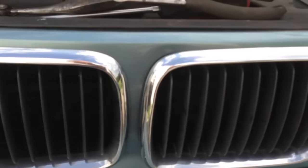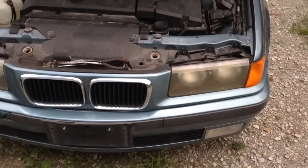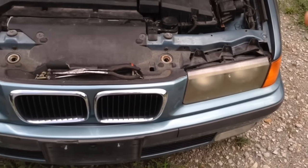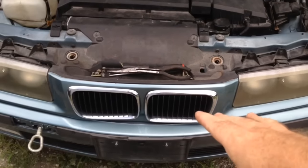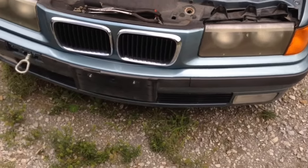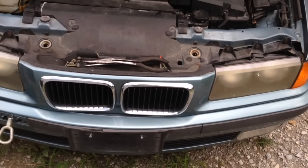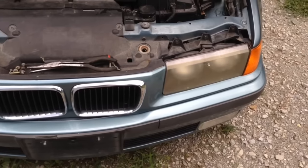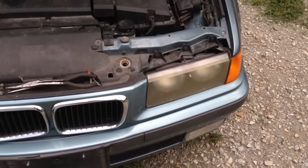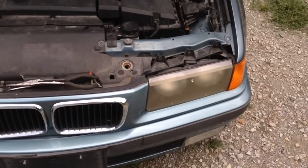Now let's give the third option — if that doesn't work and the driver's side latch is still stuck. If you follow these steps: start with the easiest inside the car, work your way to the corner light, and then go into the grill as a last resort. You don't want to break these grills. They're not that expensive but the problem is you might get an aftermarket grill that wants to fall out, bend the tabs on the grill holder or filler panel, and it goes downhill from there. Hopefully this helps you guys out — if so, give the video a thumbs up, leave a comment, let me know what you think. Thanks for watching and I will see you tomorrow.